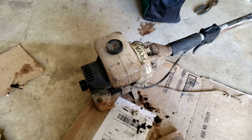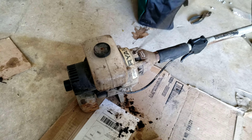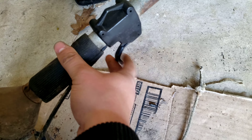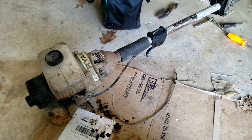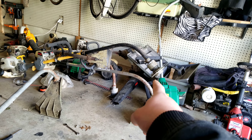This is a really cool weed whacker. I believe all I really need to do is fix this pull starter, put some new gas lines in it, and free up the throttle because the throttle is pretty stuck. I gotta be careful because the plastic's old so it might break really easily. I put a guard on it — I got that guard off of a Craftsman head that I put on that Ryobi.